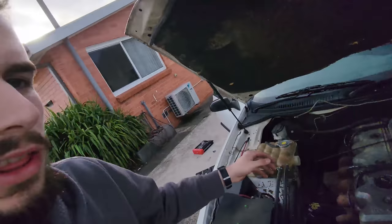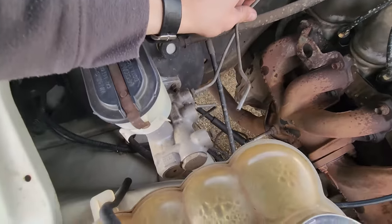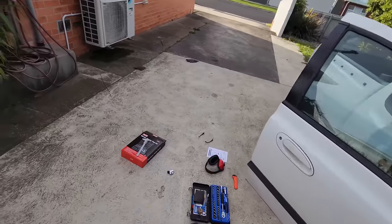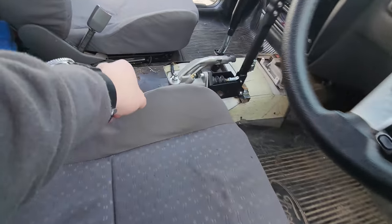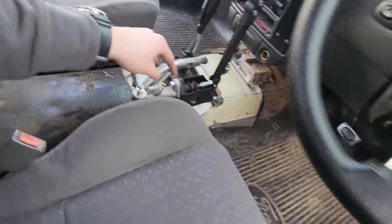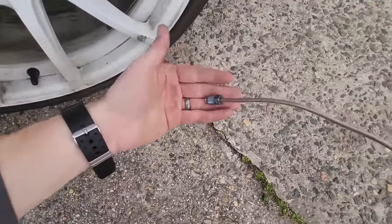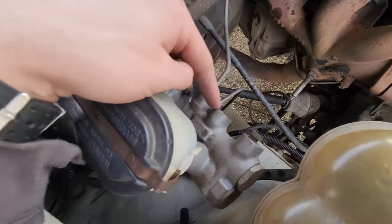I'll give you guys a quick update. This line went from the outlet - I'm going to re-bend it, drill a hole in the firewall if I have to, and it's going to go into here which is the outlet. I'm going to make a new line using the fitting that I just cut off here onto my flared line with some copper pipe that I bought from the shops, and it's going to go from the outlet of here to the inlet of the handbrake. If I can get this to reach the handbrake inside the car, we're done - just bleed it and I'll have a hydro. 250 bucks and that's including the price of this awesome flaring tool kit. Literally the easiest job.